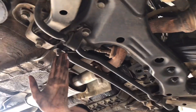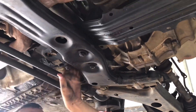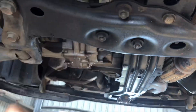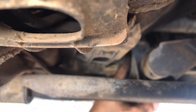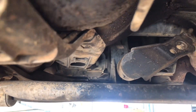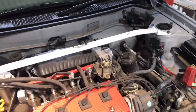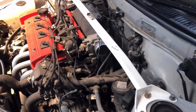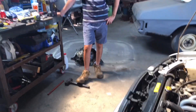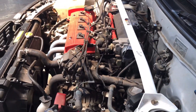There are a couple of bolts up the back of the subframe and we'll probably need to pull the sway bar mounts off — then it should just drop down. There's also a mount for the gearbox back here that needs to be removed before we can lower everything down. Jacob just undid the bolt for the rear mount on the box. Out of ten, how much fun was that? Negative two. So if you're doing this job, look forward to that bit — but there might be an easier way.